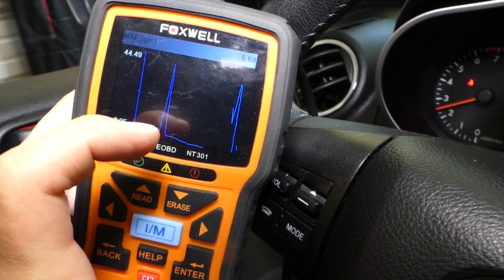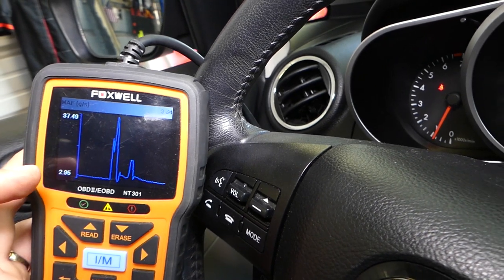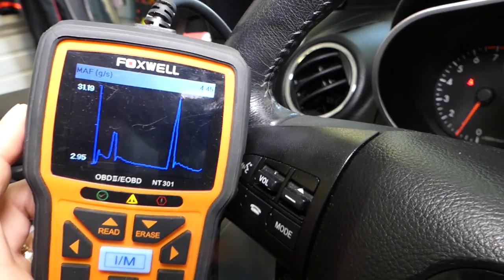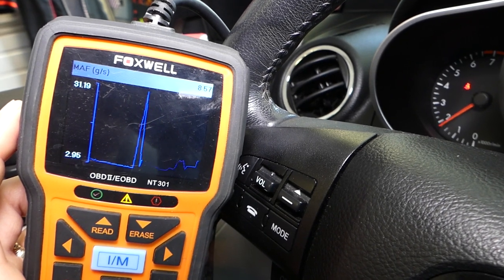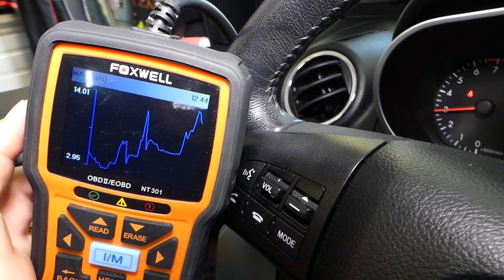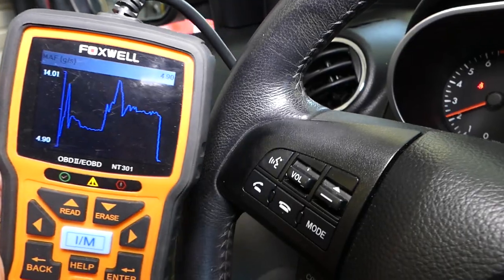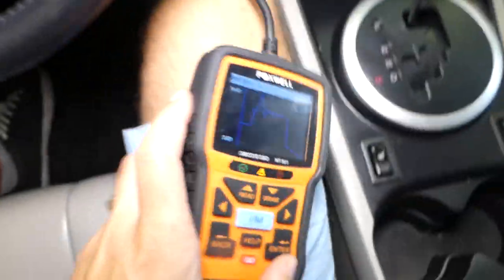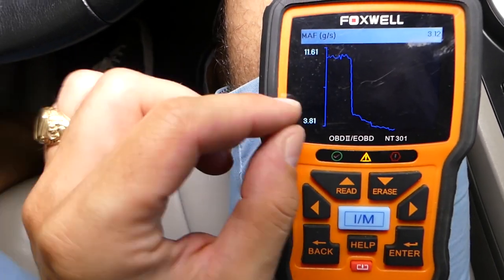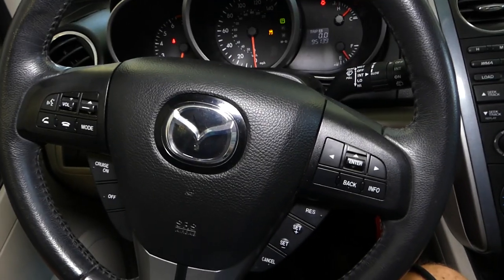If it's slow — you give it gas and it takes just a little bit of time to respond — that could be a dirty sensor. In our case it's instantaneous. It's also important when you hold it at certain RPMs to have a steady flow of air: at 2000 RPMs it stays at about 7, and at 3000 RPMs it stays at about 10 to 11, pretty steady. If it's not moving at all it's a bad sensor. If it's moving but slow, clean it and test again — that could save you quite a bit of money. Hopefully this video is helpful. Thanks for watching and see you guys next time.